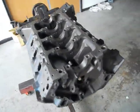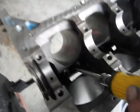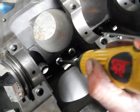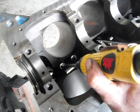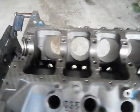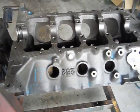So that's basically it on how to do these lifter bores. Sorry I can't really do it and actually show you while I'm going, but I don't want to risk it one-handed. That's basically how we get in there, just at that angle there. Try and hold two hands on the grinder and steady it — just slow at a time, you only have to take a bit out. After you do that it's going to leave a burr in it, so just get a tiny little polishing wheel down there. It doesn't pay to go through all your lifter bores just to clean up all the surface rust and everything. So that's all on camshaft and lifter bores on the Holdens.